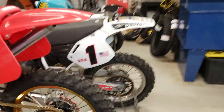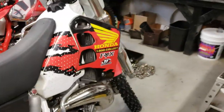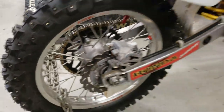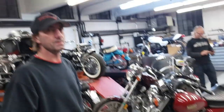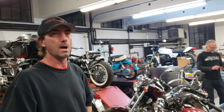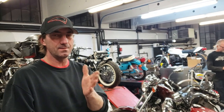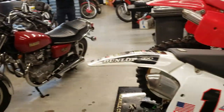This is like CR500 Central here. My CR500's ready for the Appalachian Moto Jam — stay tuned, we're going up there. I'm going to do the snow hill climb with this thing this weekend; it's got the studded tires on there. I just changed the handle over to the air filter. What about the jetting — can you go a little fatter on it? It's supposed to be 60 degrees, but up there in the mountain I'm not sure. I think I want to bump it up a couple of sizes on the main jet. Keep it safe.